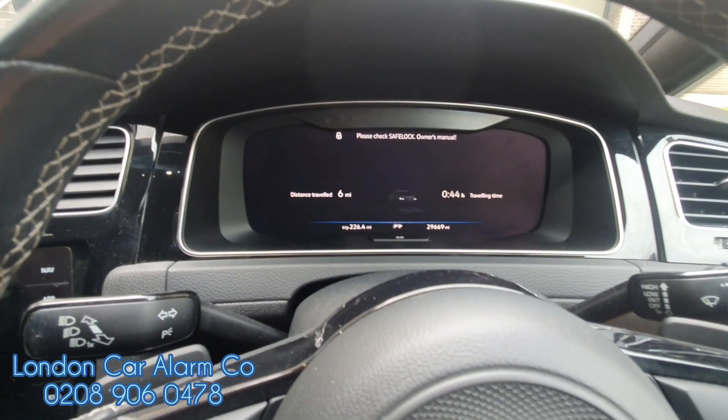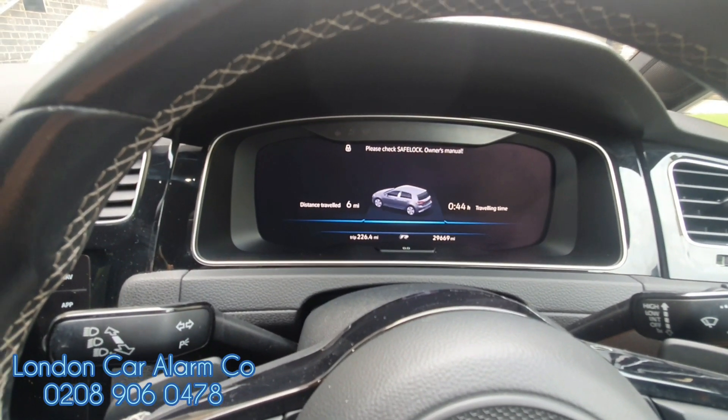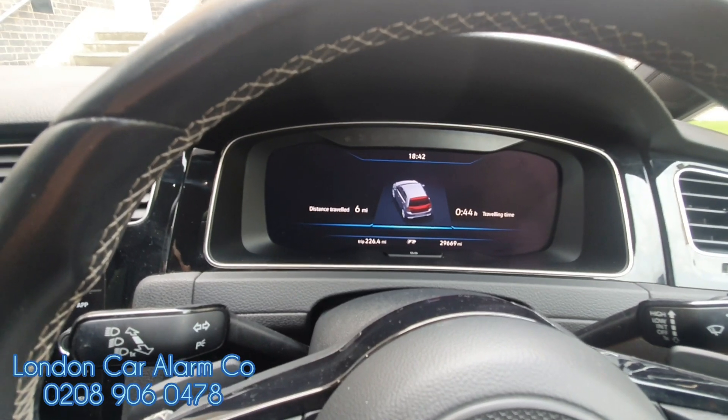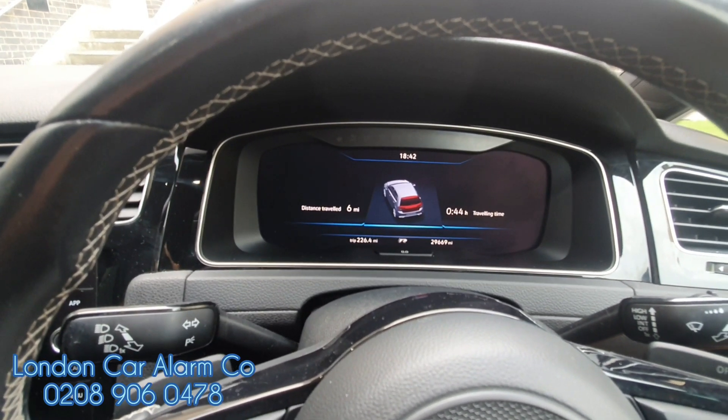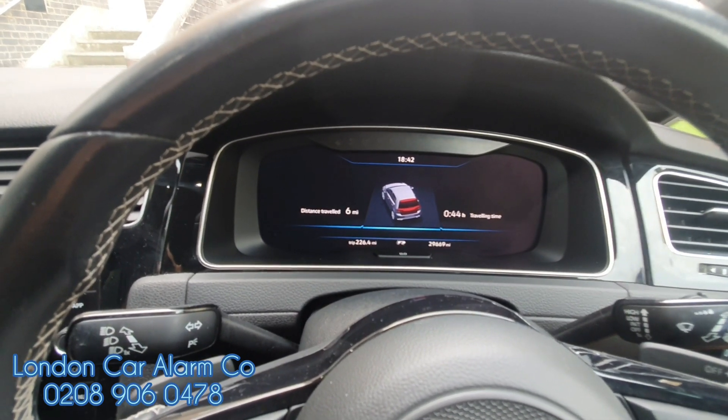Just one recommendation, very important, always on the VAG stuff: when you put the code in, just wait for the double flash to be completed, then start the vehicle, because you may get some errors coming up. So we now give it about 30 seconds or thereabouts and we try and start it, and we just see that the system is armed once again and the vehicle is protected.